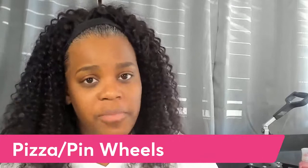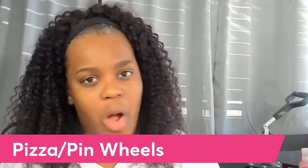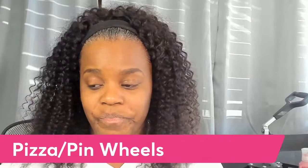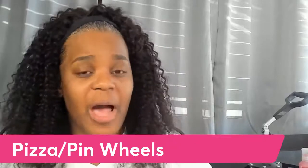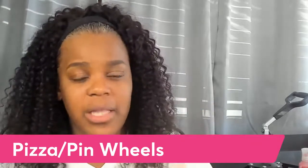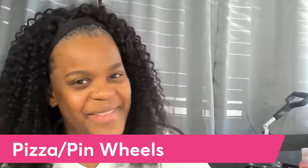You also have to clean your wheels. Even if you're using plain paper setting, if you're doing a lot of the darker colors, they're just strong colors. So occasionally you will have to clean your pinwheels or your pinch wheels. That's a part of your regular maintenance. If I'm doing a lot of prints, after so many prints, I try to clean it. After major print jobs, if I'm doing a lot of black, I try to clean it immediately. I have videos for that as well.